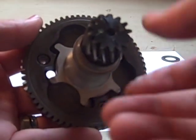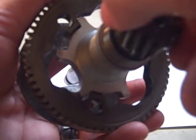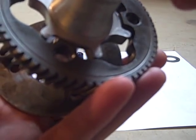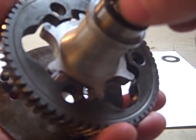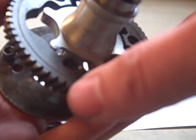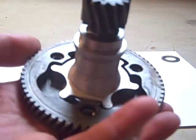One main indicator when I was first looking at the second gear was that when I turned this I heard a click on one side. After looking at it while cleaning, it looks like it had started to deteriorate the pucks and we were getting a metal-on-metal click. That can be a problem because you can end up shearing the teeth off your gears if those dampeners go completely. So probably just in time.